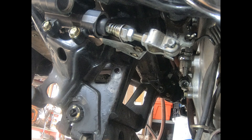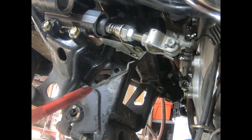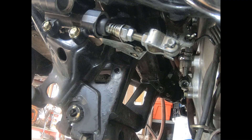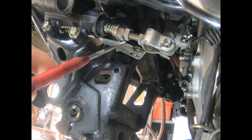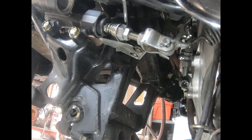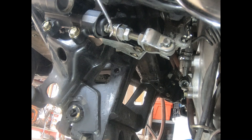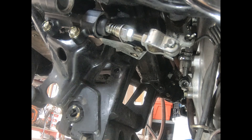We're on to the cruise cancel switch now that we've got everything in and the pedal's good. This is the two Phillips screw switch we took off right here. There's a button in there — that's the cruise control cancel switch. I'm depressing the brake all the way just to get in there. Hear that button? That needs to remain depressed and then be released when you hit the pedal.